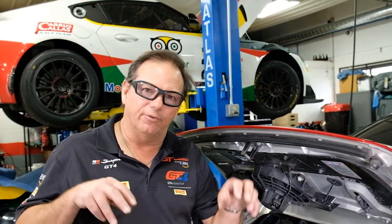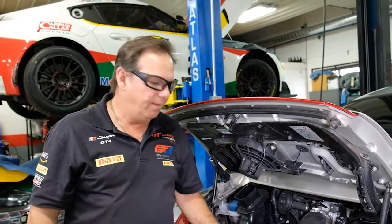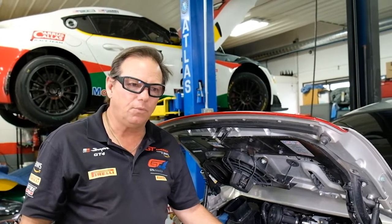I like to take down my oil pan every 20,000 miles on a water-cooled car to look at what's in it. It's like a roadmap, because it's certain areas — from the cams, and certain areas from the oil pump area. You're looking to see if the oil pickup has any glue on it or anything.